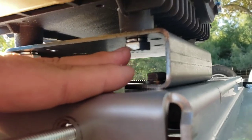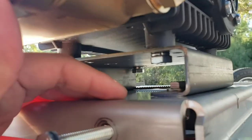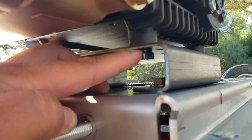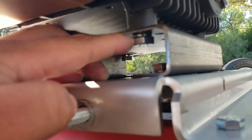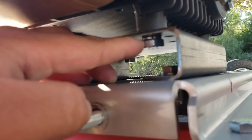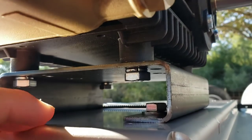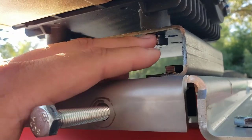Russ supplies these bolts. The pump comes with its own as well. Those are going to be a hex cap, 8mm Allen, or if you have the sockets to do it, these here are 17mm. Their thread is M10-1.25mm by 20mm long. I used from the factory the locking washer. I had resistance in bolting these by hand with this plate.